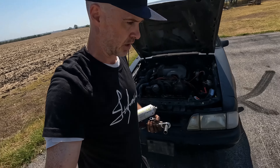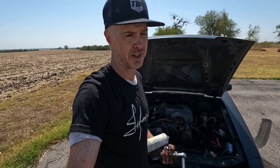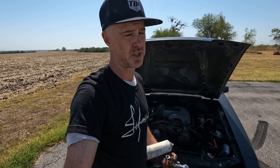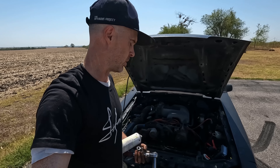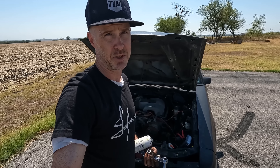That does drive things on pretty tight and breaks things loose, and that is one very interesting thing. Whoever put the underdrives on clearly didn't torque those little allen bolts down all the way. And guys, it is a pain if you don't have the right sockets — like the long allen head sockets — you really can't get proper torque on there. That's why I actually installed it on the balancer inside the shop to make sure it was all torqued down, because ultimately they came loose, started wobbling, resulting in snapping three out of four of the bolts. And the reality was the balancer bolt came out so easily — who's to say anything was really torqued down at all.